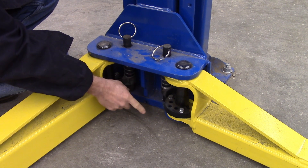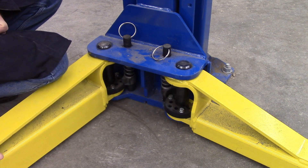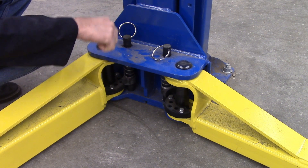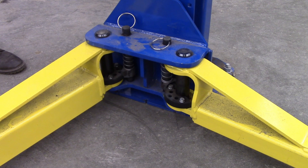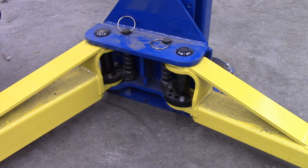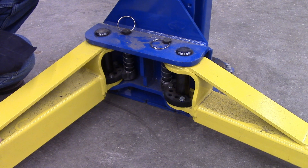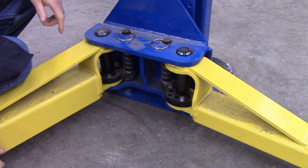This is a nice feature on many a two-post hoist: this toothed wheel engages the teeth on this lock and stops the arms from moving. I can move this all over the place, but once I raise the hoist, these will fall down and lock the wheel so they don't move. With a little bit of a wiggle before it lifts the vehicle, these fall into place. If you discover it moved, you can move it a tooth and put it where you need it to be. This stops the arms from splaying out and dropping the car on your head.